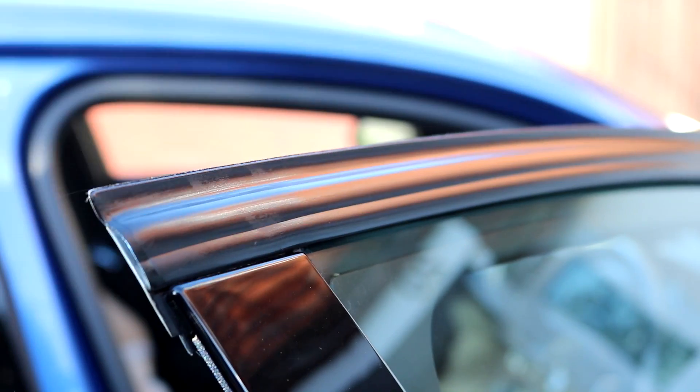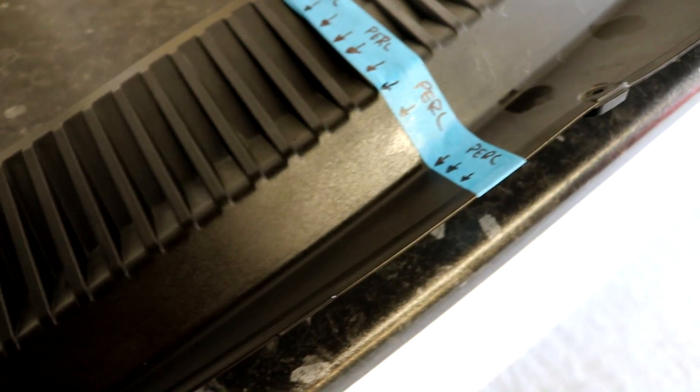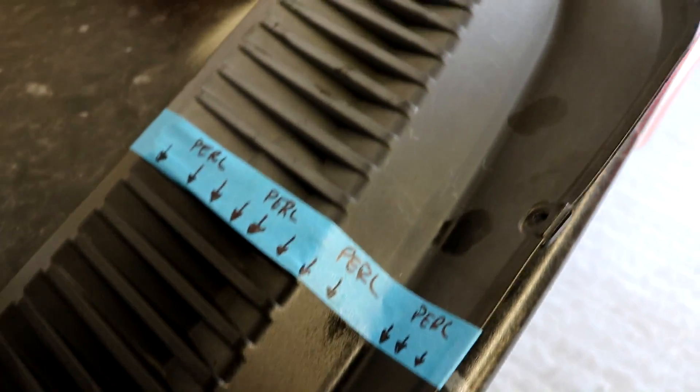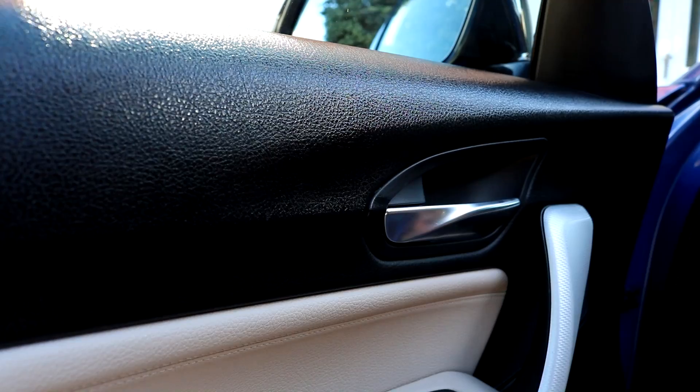The second reason — and a really important one — is that it does everything well. All of the different types of dressing within the rubber, vinyl, and plastics category, you can use it for. At the lower concentration of one to five, you can add gloss to your dashboard, and that gloss will dry and won't leave a slippery oily finish. It functions really well as a dashboard dressing, interior door card dressing, door shuts — all that plastic stuff does really well at one to five.